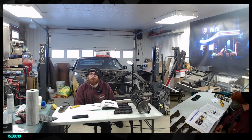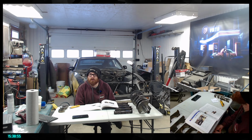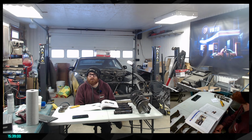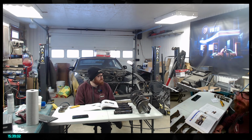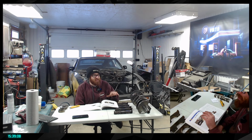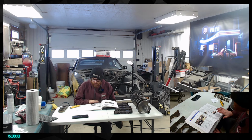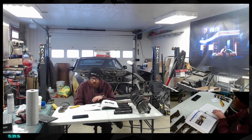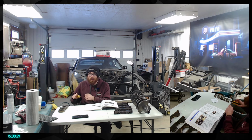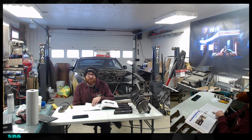When talking plastic gauge measurement, make sure to torque all fasteners around it, since some blocks will slightly warp when untorqued. They make fancy torque plates for some engines. Okay, I don't think there's going to be a torque plate for those, but basically I need to torque everything in a sequence to make sure everything goes to its place. Everything is explained really well in that manual here. So that's something we're going to take a look at and make sure we're doing properly, because I know it might change a lot of things.